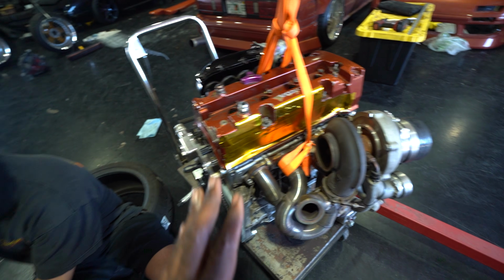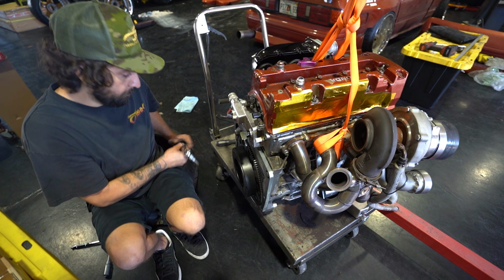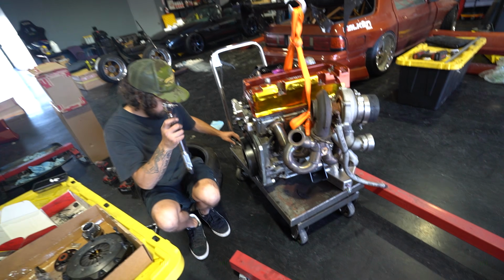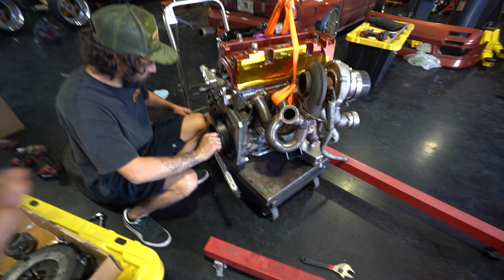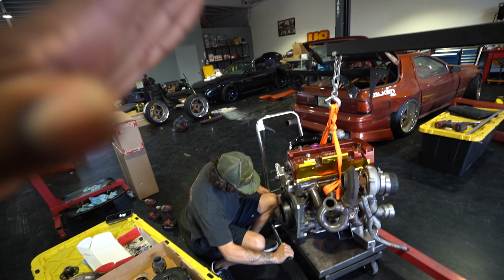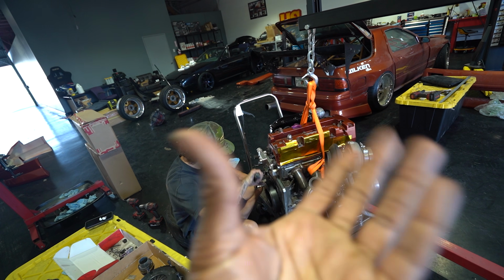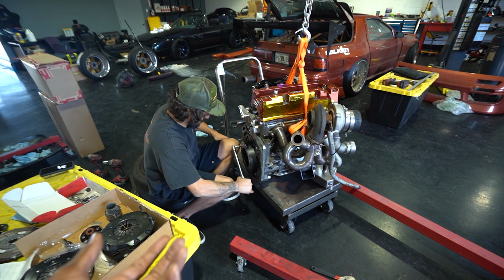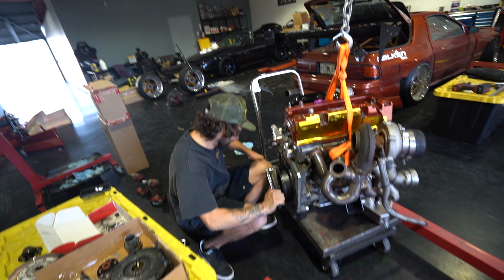The harmonics on the K24 are pretty aggressive. You need to Loctite everything, and everything wasn't Loctited previously. So because of that, at SEMA during the Burnyard, you saw your boy getting rowdy. Rough harmonics on the limiter for a lengthy period of time, bolts are gonna rattle out. So unfortunately, I had a couple transmission bolts rattle out. Pretty much most of SEMA, the bottom of the transmission was Pac-Manning. It was just bop, bop, bop, bop. I heard it making funny noises, but I thought the transmission was just blowing up. I didn't think it was falling out.